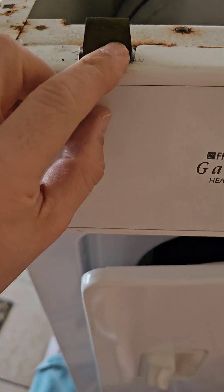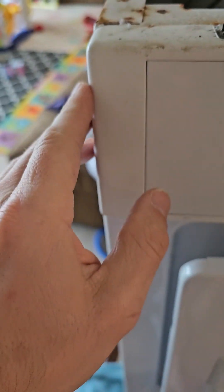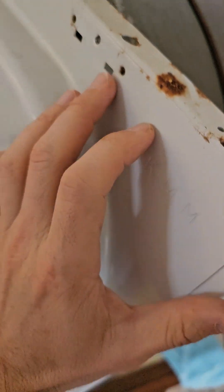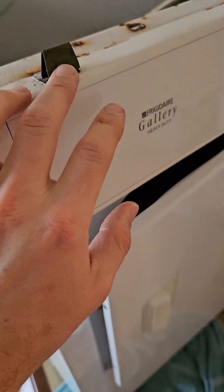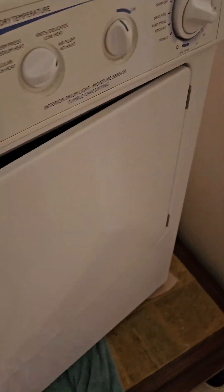Generally, all you need to do is press with a screwdriver — some sharp flat object — underneath. Locate the clips on the sides, there's one here and a second one, and then on the back you'll have a fixture holding it. What I did is I unscrewed the aluminum fixtures, one and two, then accessed from the front, used a screwdriver, exerted some pressure, heard a little click, and at that point you're able to lift the platform. Then it's self-explanatory — but the kicker is to find the buzzer.